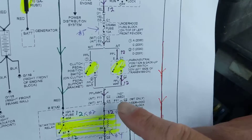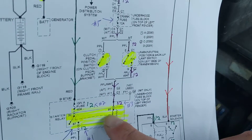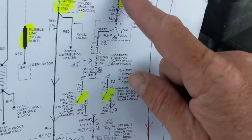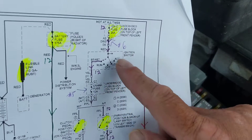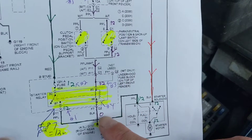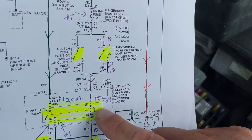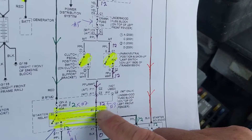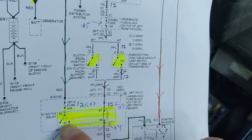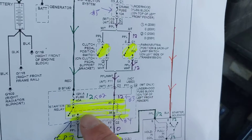As you can see, there's a relay right here — this is the main relay. First, you turn on the ignition switch; current comes here in the start position, through here and through here. We went over this many times. It activates the coil — I call this the input. Once that happens, current flows and closes the switch to pin 87.